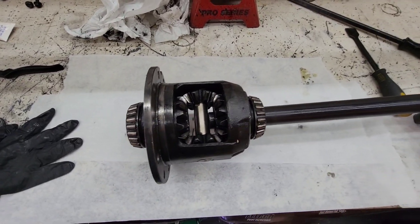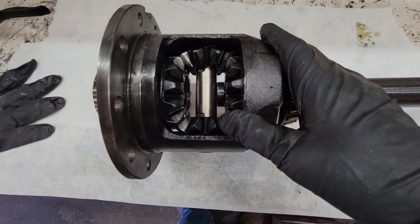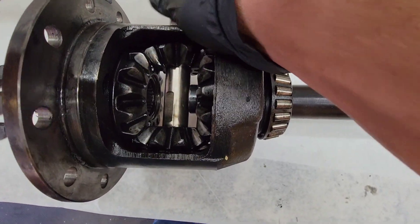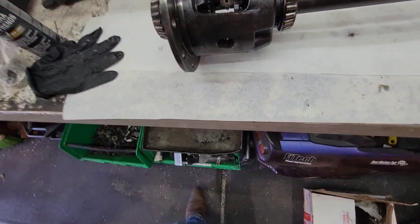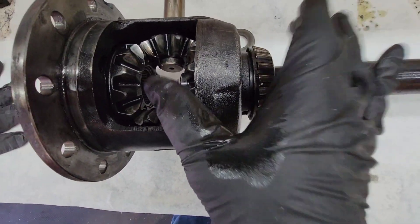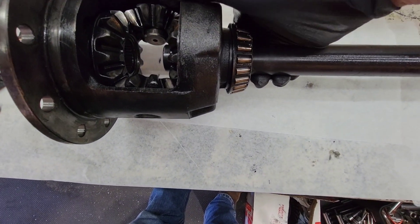The question of diff welding comes up a lot. John Duncan's write-up on shimming and tightening everything up before you weld is really good, so let me explain this quickly. We have an 8.8 carrier with the ring gears off, axle sitting in it. This long thing is called the cross pin, and in there you can see the end of the axle — it's splined and has a groove for the c-clip. This is how the axle is held into the whole rear end housing.